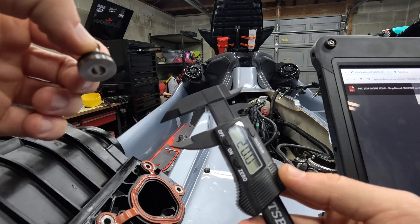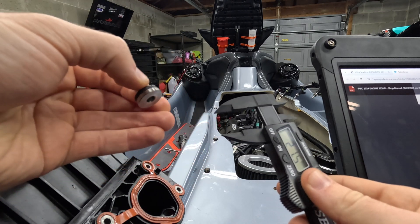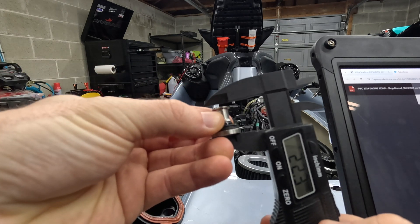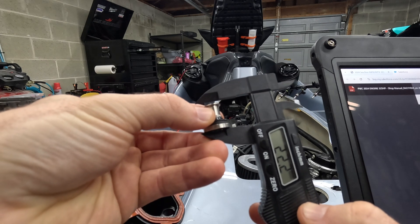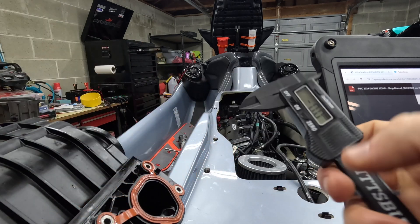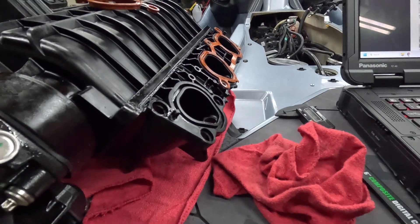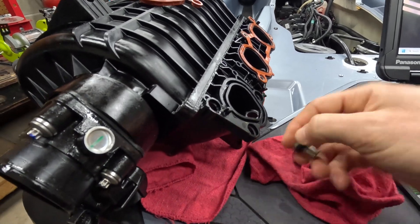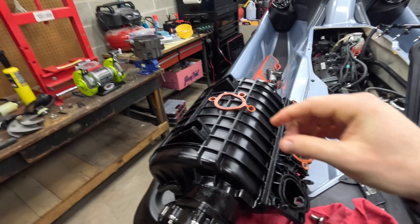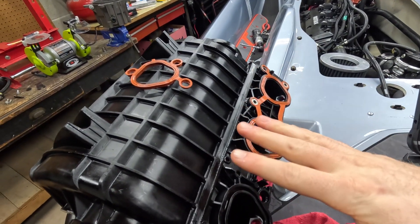I did this modification right after I bought the ski, so it has about 40 hours of runtime with this fix and the problem hasn't come back since. You can see this one is about 22mm — you can see just how much material needs to be shaved off. When you shave the material off, all you're doing is reducing the room the stud has to back off the block, which gives more room to squeeze the gasket. The tighter the gasket, the more boost it can hold and the less chance of leaking.